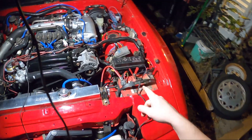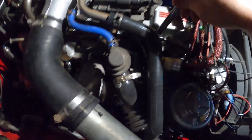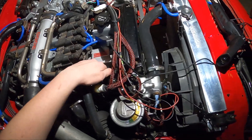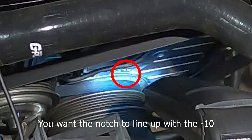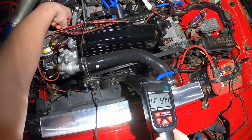We're going to go ahead and start the car. Okay, that's good — that means it's having a hard time running, so that means the timing is a little bit off. Now let's go do the rest. So with the trip wire on, I'm going to connect my timing light — it's connected to the number one spark plug wire. I'm going to come over here to the camshaft position sensor and then loosen up the bolt so that way I can turn it. I have it just loosened up so I can turn it. We're going to make that light hit 10. You can see our tachometer right here — it's around 650, which is great.